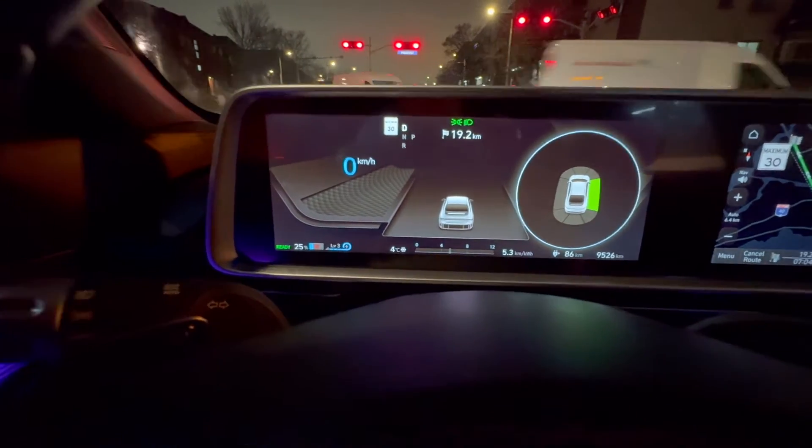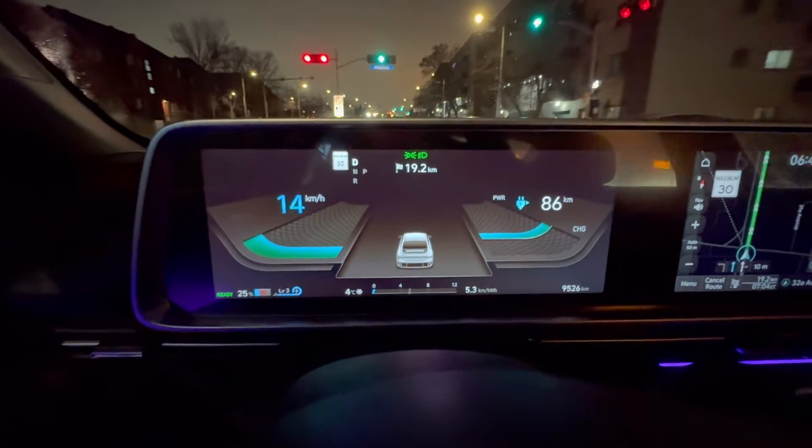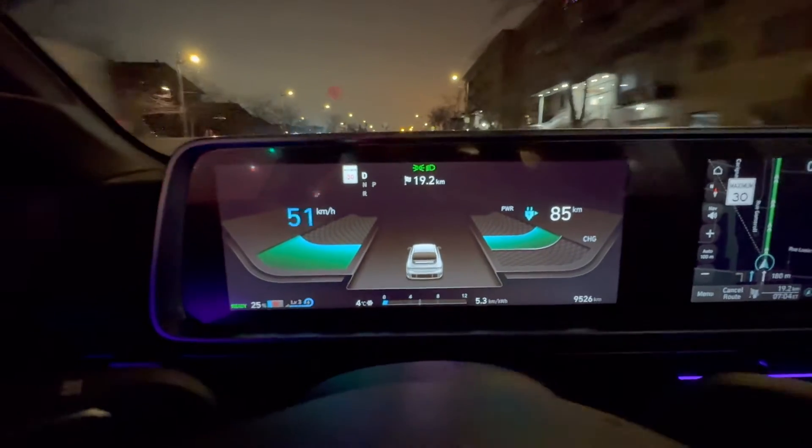If the Electrify Canada site doesn't work — it's a 350 kilowatt charger — we're going to go to the site in Laval where I had the Polestar 2. I really want to see some big numbers with this car. I'm going to try to precondition the battery. The battery preconditioning in this Ioniq 6 is very convoluted — it has to be a certain temperature, a certain state of charge, a certain distance. I wish it was just like Tesla where you navigate somewhere and it starts preconditioning right away, or just give me a button that says 'battery preconditioning.' We've got battery conditioning going — there's a little red symbol in the battery — so hopefully we can get some good numbers on this charging session.